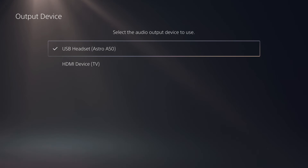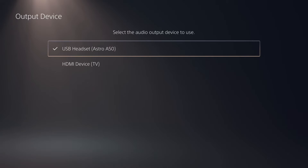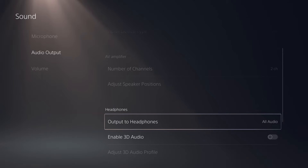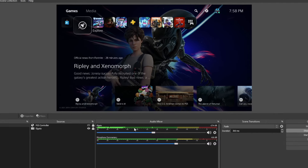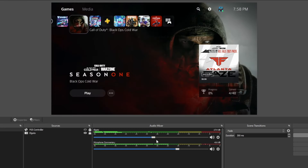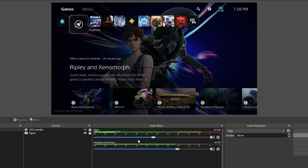I figured I'd also mention that you don't have to necessarily stick with HDMI Device TV — you do get a different type of sound when you run the USB Astro A50 or A40 headset option. But if you want to have your audio recorded and run this kind of setup, you want to make sure that your output to headphones is set to Chat Audio, and then all your audio will still be recorded that way. As you can see within my OBS, you see the Elgato sound levels going as I have my Astro headphones on — everything is wireless at this point and the audio is working. Below that I have my commentary microphone, because you're going to need two microphones if you really want to run this setup correctly: one for your PlayStation 5 and the other for your computer for commentary.